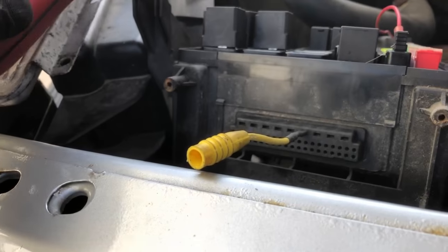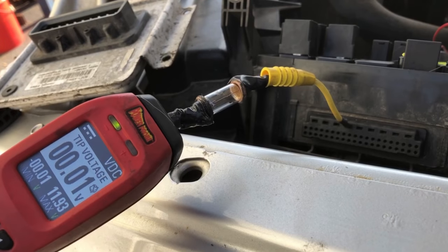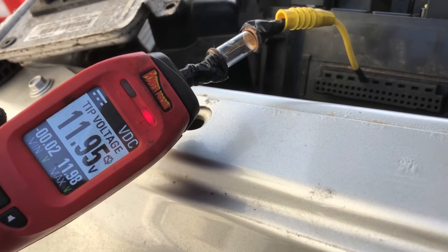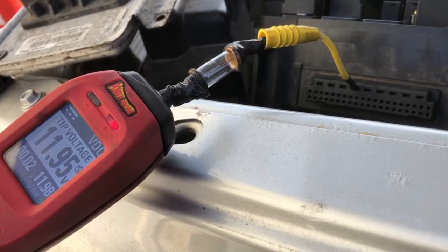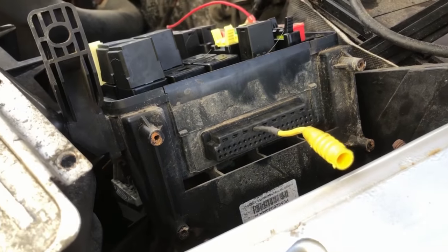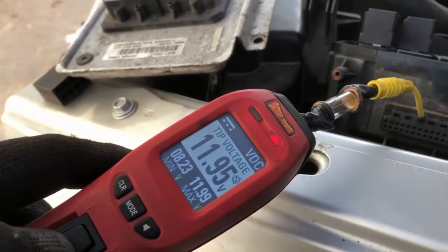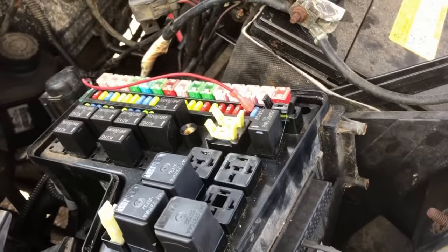We can light it on circuit one. Now we'll go to circuit two — the circuit that set the fault code. We have 11 volts, but it will not light the bulb. That tells me we have high resistance in this circuit. We have enough getting through to show us voltage — close to source voltage, only two tenths of a volt off — but it can't do any work, it can't carry any current. So this is your option in a scenario where you can't do a volt drop test but you need to verify that the circuit can carry some load.